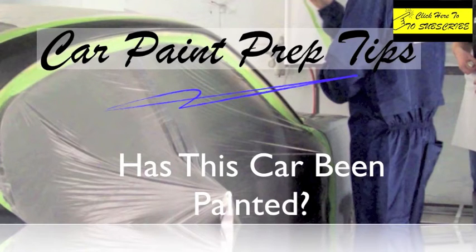So I know a lot of you may think that masking's not that important in the overall picture, and rush through those steps, but actually this is something that you want to do really good. Take your time doing it, so that after the car's painted, you can't tell that it's been painted, because the objective of making a repair is to make an invisible repair. So take your time when masking, and do a really good job with that.